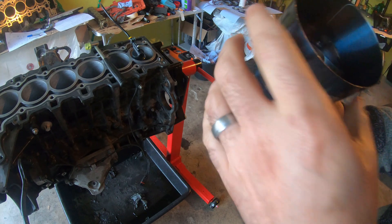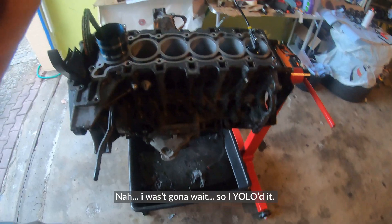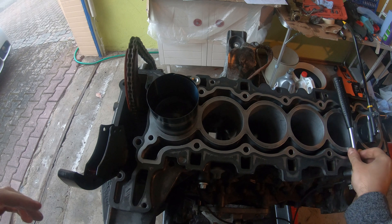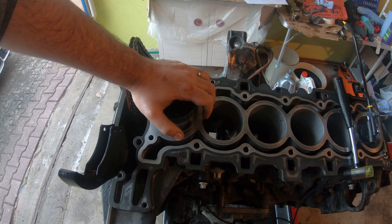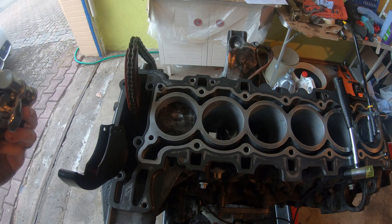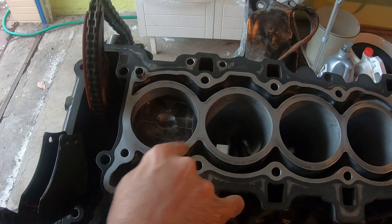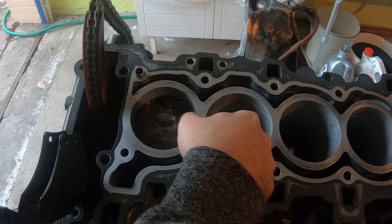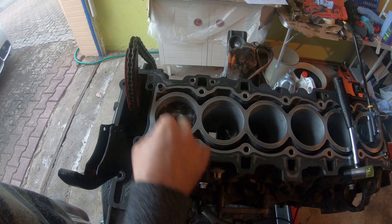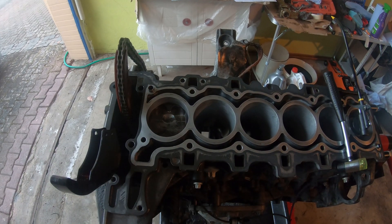It's oval — I can see the gap over here. On my fifth try I finally get it in. What I did was I pushed really, really hard down on this and then I tapped it in, and voila — we have piston number one in. Everything still looks okay. I kind of nicked this little bit here, but that's on the cylinder wall at the top, so that's okay. Piston number one is in — now we've got to do the rest for all six.